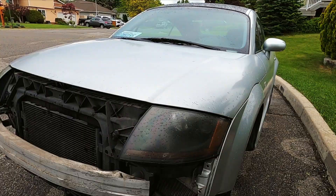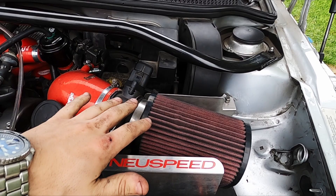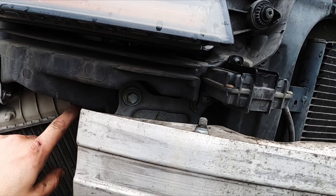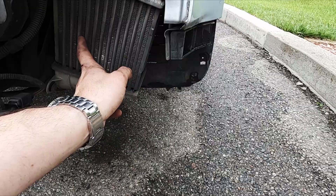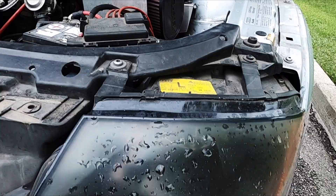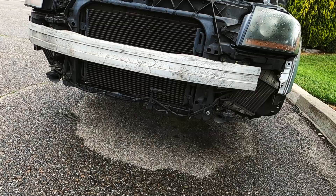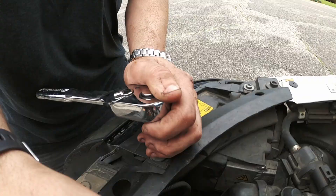Now that the rain finally calmed down, we can continue. Let's look at the turbo system to see what we're actually replacing. Air comes in through the intake, goes down into the turbo where it's compressed, and then routed across the engine, up top, down below the headlight towards our first intercooler. This connects under the car to our second intercooler on the other side, which is then routed up and into the throttle body. The goal of the intercoolers is to cool the compressed air from the turbo — engines run a lot better when they have cold air entering the system. The stock twin intercoolers on the 225 are pretty decent for what they are, but we want something a little better.